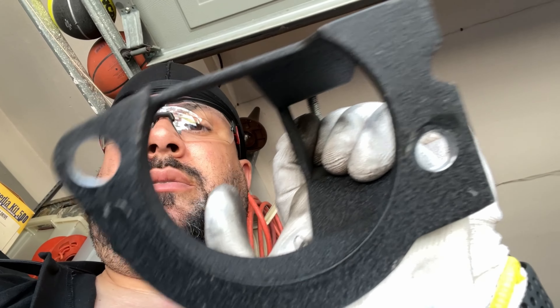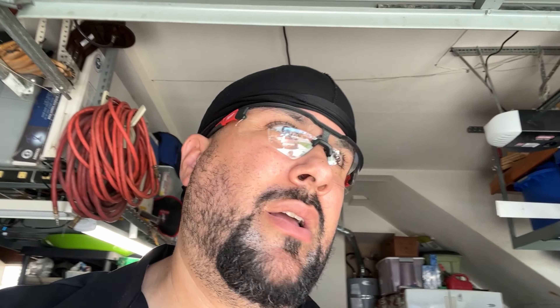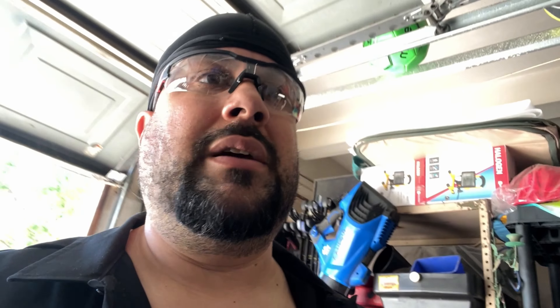Got the taco meat out - these are the stands for my rear strut tower bar. Normally you'll see it in the back of the window here. I got these little Cusco quick release jams and I went to go put them in, but because they center the strut tower bar, the wiggle room that you have goes away. So what I did was I took a stepped drill bit and widened these holes - I'm gonna do the same with the other side - so I can put the bar in, fit the Cusco pieces in, and move it around to where I need it. The bar just drops in, has the same effect.